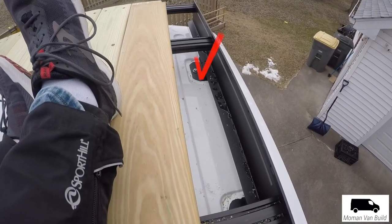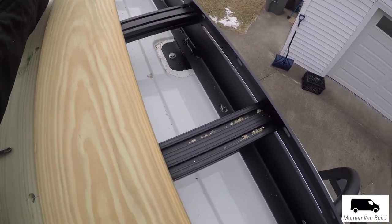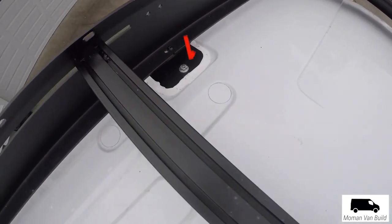I'm shocked that some of the other plugs up there where the inserts are and where the wire inserts can be — that they're not leaking. The transits are notorious for those leaking, because it's just a simple rubber thing and it looks like it's painted, it's not really even sealed. So I went up, and as I was putting the roof deck on, I put Dicor lap sealant on all of them. As soon as I put that on and we had rain or melting snow — no leaks. It's been bone dry in there. When it gets a little warmer, I'm going to cover all the remaining round inserts for wires with lap sealant just to be safe.